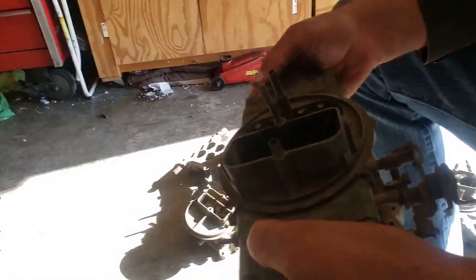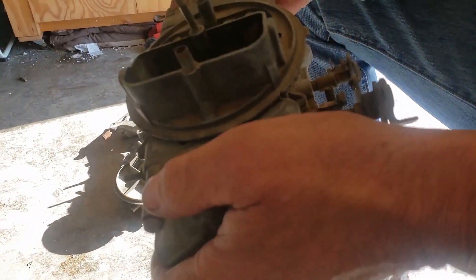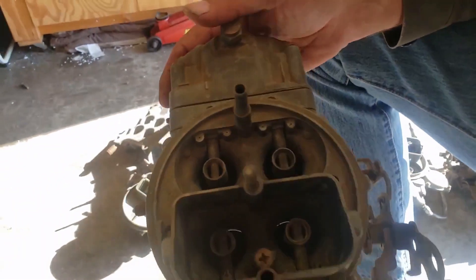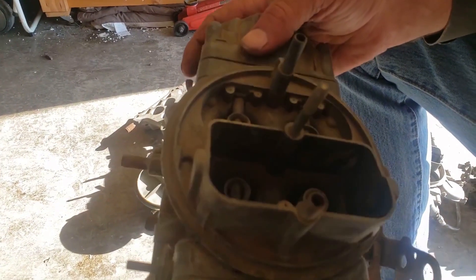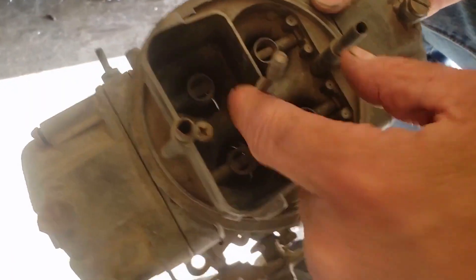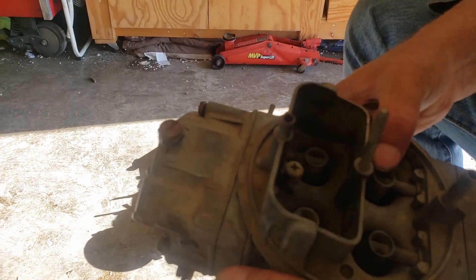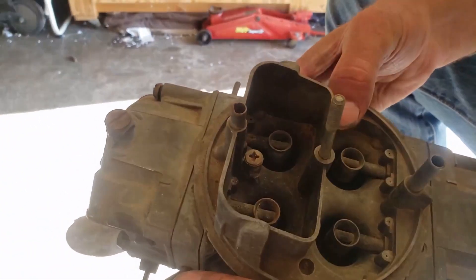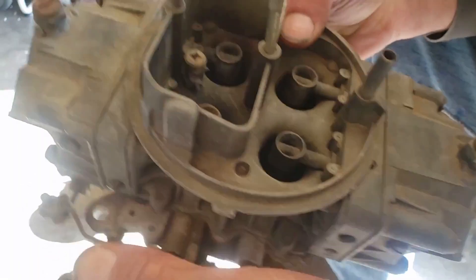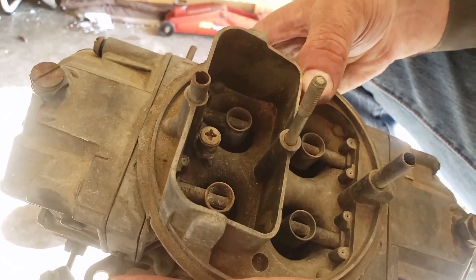If you're building a small six cylinder or a very small V8 — whether it's a 300 Ford, a 250 Chevy, or a 225 Slant 6 — you could get one of these four barrels. This 390 CFM unit is tiny, does a really good job mixing fuel especially at wide open throttle, and because the barrels are so small the velocity stays high for those little engines. That's a good option.